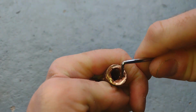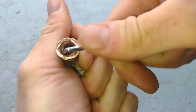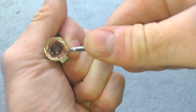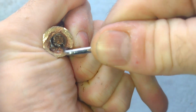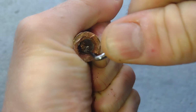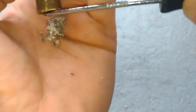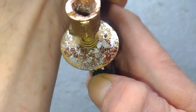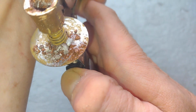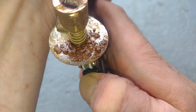So you can just see the wax on the side of that capsule there that's dried, and that when heated will melt, and that is what then acts on that rubber diaphragm and forces that piston out the top. So I've got it sped up here. I'm just heating it up with a lighter just so you can see the wax actually melting, and then obviously that will expand and force the piston out.